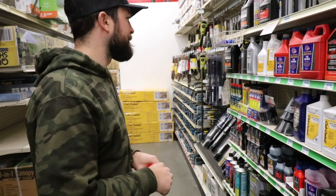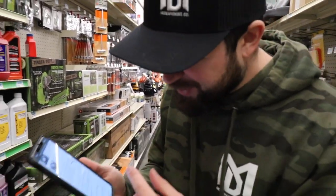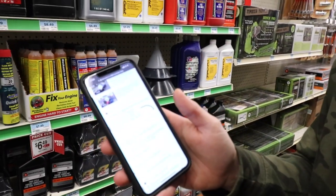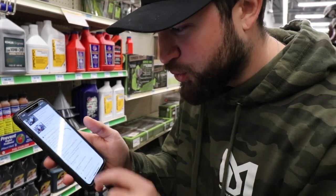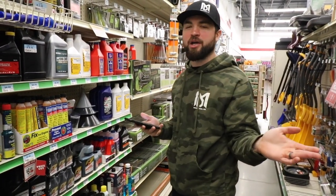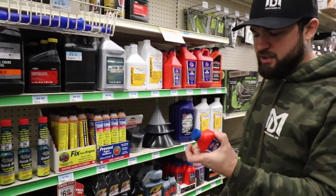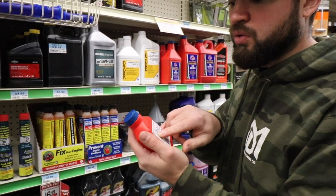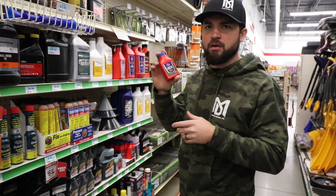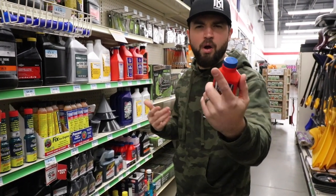100 to one it is. Let's do the math. The wonderful power of Google — literally Google the fuel tank size for a 1984 Mercedes 300D: 21.1 gallons with a three gallon reserve. We're at half tank, so we'll estimate 10 gallons. If it's 50 to one per one gallon, it should be 100 to one per two gallons. Correct us if we're wrong.